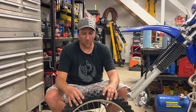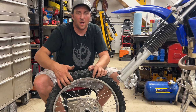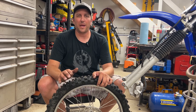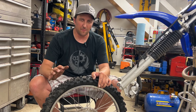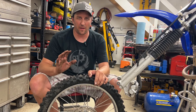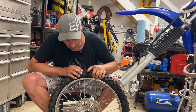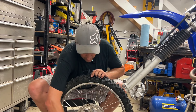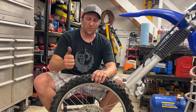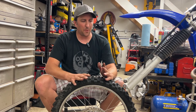The tire wasn't centered on the rim. We called Justin — he's a dirt bike legend in the Edmonton, Alberta area, the dude can ride single track like nobody's business. He gave us the advice to let the air out of the tube, squeeze the bead, pour soap in all the way around, and then put some good pressure in. We got almost 40 pounds in and the soap definitely helped — now the tire is seated properly, so we're going to put it back on the bike.